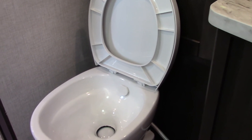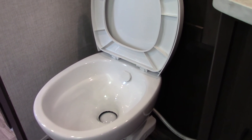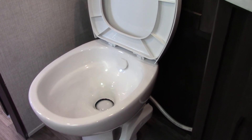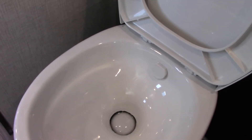If you're going to stay at the campsite for another week but have to dump the tank, you would dump your black tank and then come back inside and repeat that procedure — put the chemical in and add a gallon or two of water to get started. You can't use it dry or without chemical.